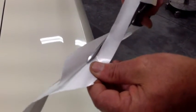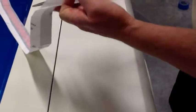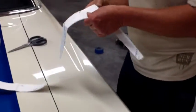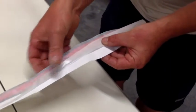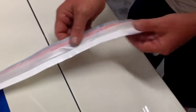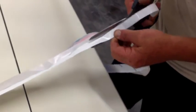The doors worked pretty good, but on the fender on the other side we had to pull the old sticker out of the inside of the fender. As we're cutting the paper back, leaving this sticky bit, this part is sticky, you see, it sticks to the car, and that'll be your initial stick. So we basically take it up, upside down, fold it back like this. This one doesn't need to be super close. You can be a little bit off because this is just a temporary hold until you get the hinge point on the bottom.